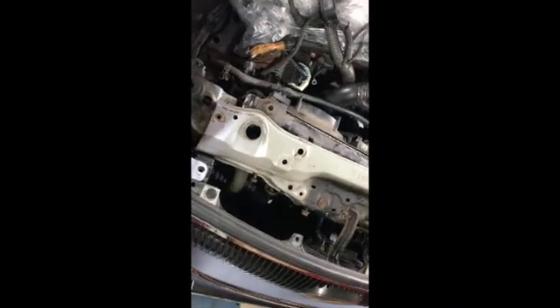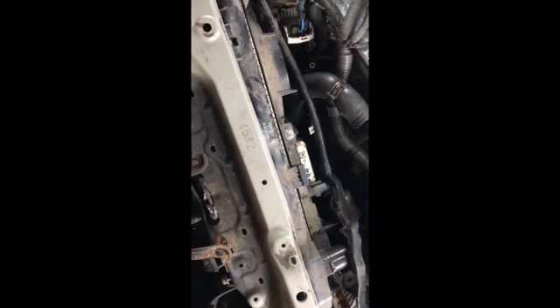In the process of trying to remove the radiator — partly to replace it anyway, and partly to give more room to get down to the crank bolt. We've removed a selection of bolts along the top to loosen the panel, disconnected it from a bolt through the head and the same on the other side holding it to the condenser. Also taken out four bolts in an effort to loosen it from the bonnet catch, though that's not proving very fruitful at the moment.